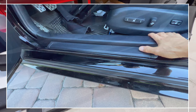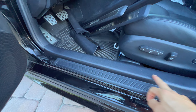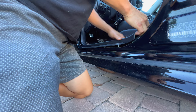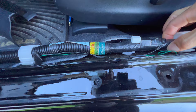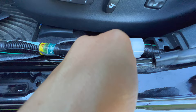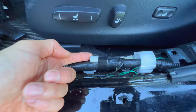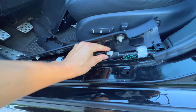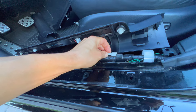So to remove this it's pretty simple. You could probably pop this off without any tools, just by hand. Once you get in there, just pull the plug right here, plug it into the new one, and snap it back on — that should be it. Once you get in here, look around this area back here and you'll see the plug right here in front of my face — the white plug right there. In the past I've tapped other stuff to use this light. You can see the wires coming out of here and this green wire going up that way. If you don't have this plug in your car, you're going to have to pull your own power, and the best place to find it is the LED that goes underneath for the door light right under here — you could tap it there. To install it, all you have to do is just plug this thing in, snap it back on, and that's it. Pretty easy, less than a minute install.